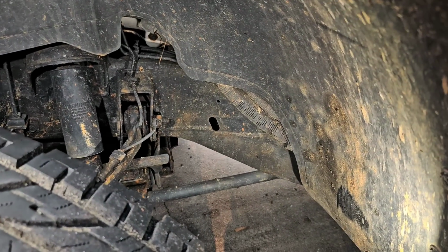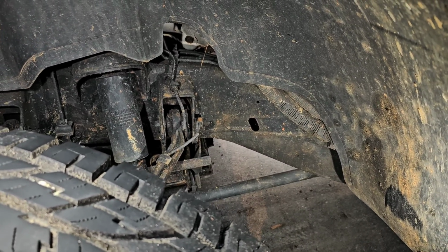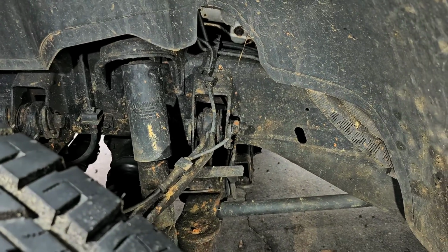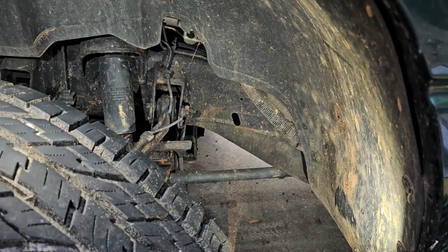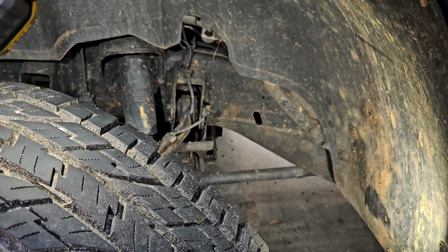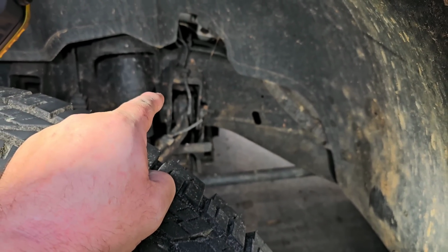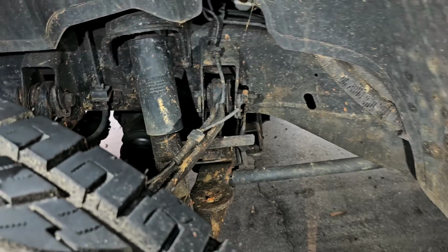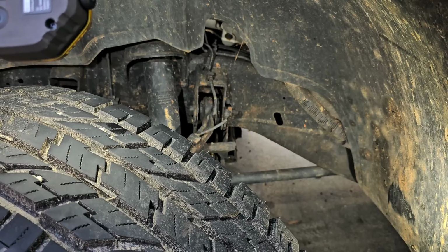Now, the biggest problem is, I don't know how well I can get in there to show you this, because you might be in my way. Because for me to work, I got to work right here. So I don't know. How am I going to do this? Let me devise some way of doing this, and then we'll do this repair. It's probably easier if I pull that top harness out because it goes to a plug right there, and just clean it up and fix it there. And then I'll pull this one out of that grommet right there. This way I have it up in my face more to actually do a repair. All right, let me come up with something and then we'll get back to this.